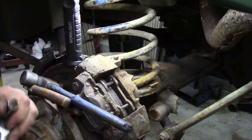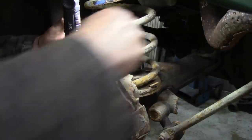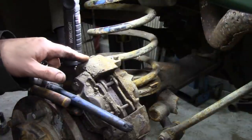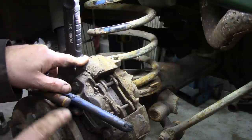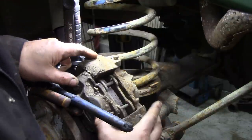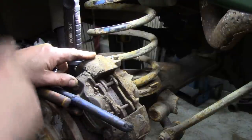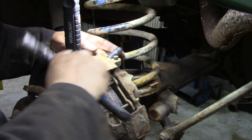You can see it's even rusty inside — what a mess. The next thing we're going to do is try and get the bleed screw out. Now this is tricky to film and also tricky to get into. We need to get the bleed screw out so we can bleed this caliper properly. However, this might be in our favour if it doesn't come out, because now we've taken the pipe out, we can see there's no fluid leaked out — it can't get air back in, it'll just hold fluid in. So fingers crossed, if this doesn't come out, we still won't have air problems. But you really, really need to get the screw out, and they are notorious to get out.